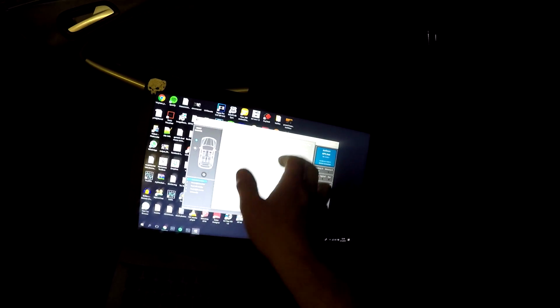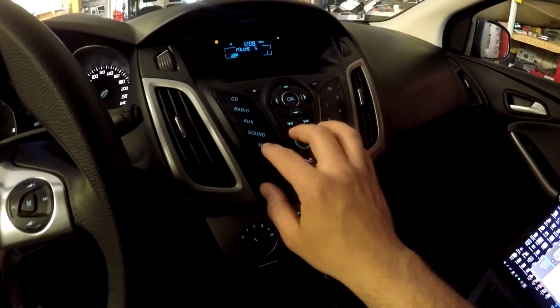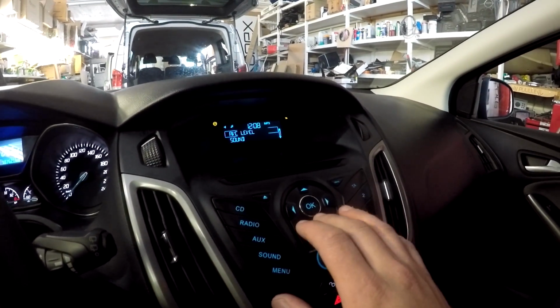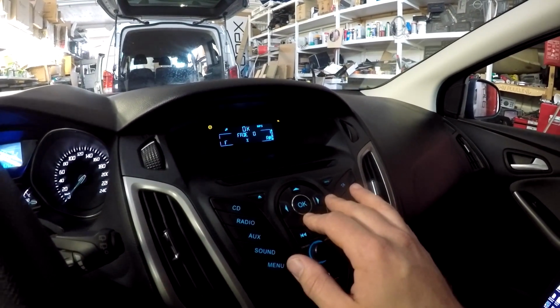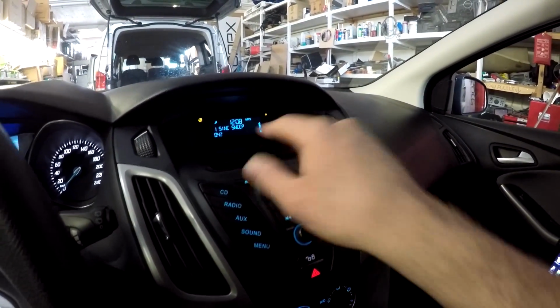Then we go to start, and we select front, rear, aux from the input channels. Then we need to set all controls to zero. Now, in this OEM head unit, I actually don't know how to use it, but let's go into menu, then audio settings, sound probably. Treble is at zero, then middle zero, bass zero, fader, balance, everything is at zero. Then back to CD and sine sweep.